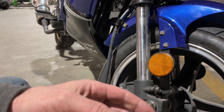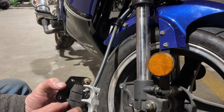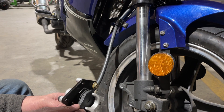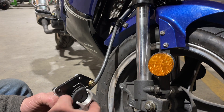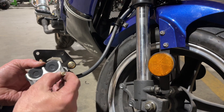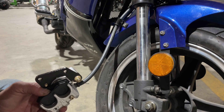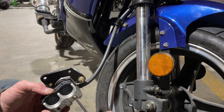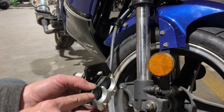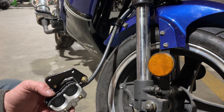Now we have our brake pads. When you get your new brake pads, they're going to look just like this. All you're going to do is the same way we took them out — we're going to put in the back one first, and just push it in like that. Now we're going to get the next one, and it goes in the front on the little two tabs, and we push them in like that. We can hold it with our thumb, go ahead and put that pin in. We'll screw it in just a tiny bit to make sure it's holding both of them in. Then we can get the other pin, put it in, and the more you push down on this, the more it'll make sure it's in place. Then we can go ahead and tighten it up. Now our pads are back in.